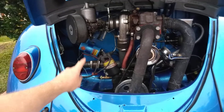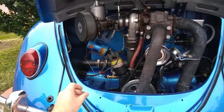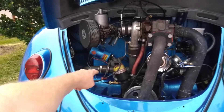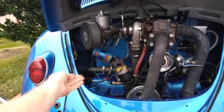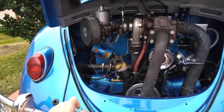I looked in the manifold while I had it off, and the restriction in it is not as bad as I remembered. It is smaller in diameter at the base and a little smaller in the neck, but it wasn't enough to really warrant pulling it all apart compared to how small the heads are, so I left it.